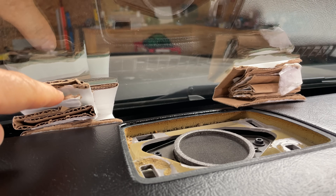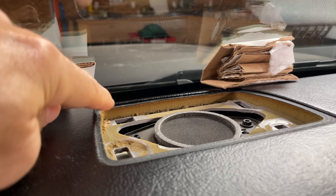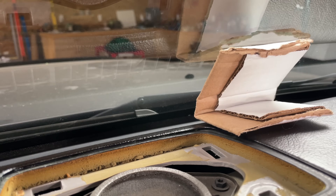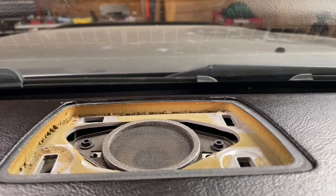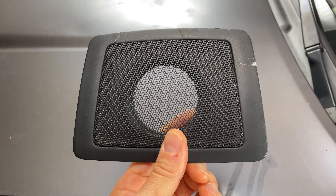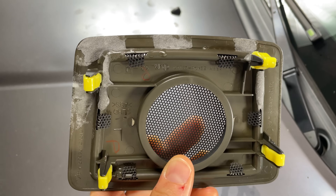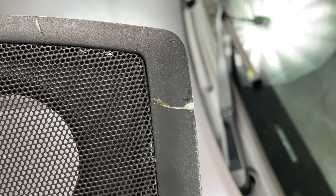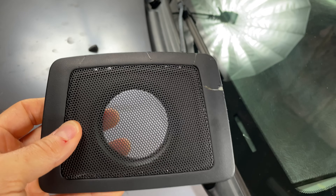And yet again, it is now the next day. Let's see if these wedges were able to do their job — it looks like they were. I'm hoping the silicone is doing its job, so let's remove these and see if that panel stays down. That's really, really good. This area back here that didn't get glued down the first time looks like it is now glued down — so that's a really good thing. Now for the final piece on this dash, which is this center speaker cover: I spent some more time with some glue and baking soda trying to really reinforce all the cracks here. I think I'm going to take some sandpaper and just sand down the edges that are going to come into contact with the dash. As for the top viewable area, you can see right over here on this corner, this piece didn't fit back together quite right and there was a little bit of a gap — which is one of the reasons I wanted to use the baking soda trick. But overall, while not perfect, I was able to get all those globs of glue off the top here, so I think it's really not going to be noticeable.